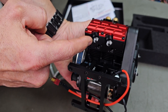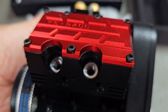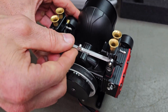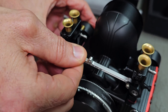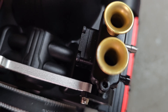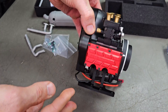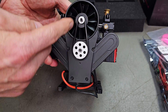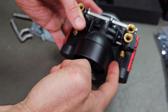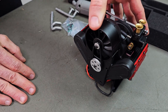So there's your two cylinders — you screw your exhaust header just on there like that. There's a single bar here that's going to adjust both carbs. They look really cool. I don't know if you can see inside them. I'm not going to touch them at all — I just want to leave as-is and see how it runs. Looking at the front of the engine, as you can see, it's fan-driven. It's got a nice cover that's obviously going to help direct the air directly onto the cylinder, forcing it onto the block to keep those cylinder heads nice and cool.